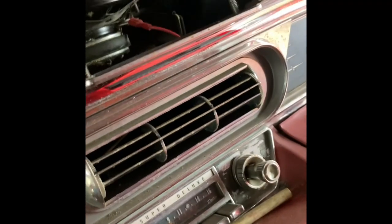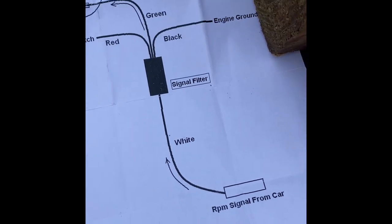Make sure y'all remind me to plug this red wire back in because if I don't I'm not gonna have any tunes on my AM radio when I turn it on. I do hate wiring - it's not fun. I'm gonna start with the easiest thing, which is the RPM signal from the car. This white wire on this box - I'm going to run it through this hole in the dash that kind of comes down, through this hole in the firewall, then loop it into these other wires and vacuum lines along the firewall and put a connector on it to hook to the negative side of the coil.